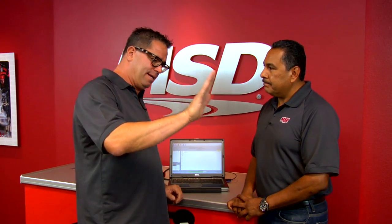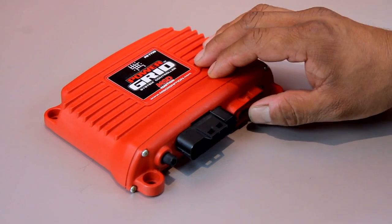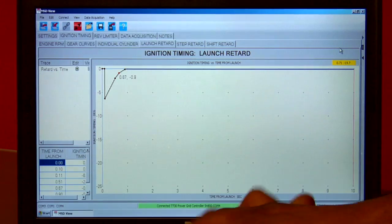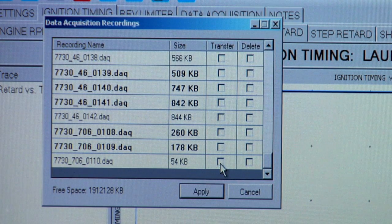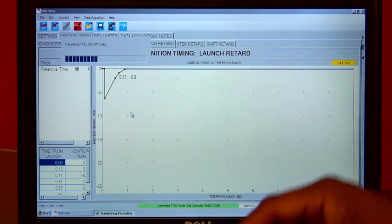Let's say I just made a pass, got to the end of the track — I've got this data from that pass. What's the best way to download it? Let me show you, it's pretty easy. You can either extract the card and pull the data off through a card reader, or you can connect your laptop to it and simply hit F7, and right here it shows you in chronological order all the runs that you've made. It'll store all these runs from one pass to the other. Let's just extract the last one — turn all the X's off, pull the last run off, pull it up. Right there, it's transferring it.